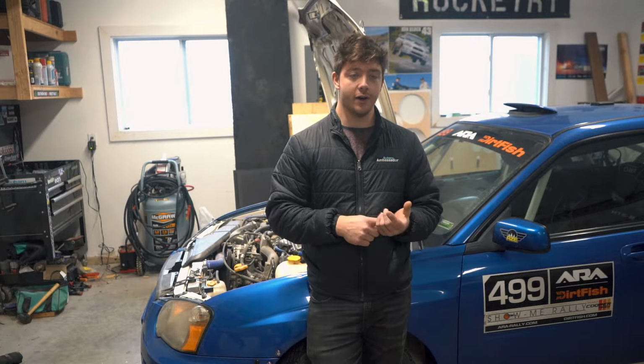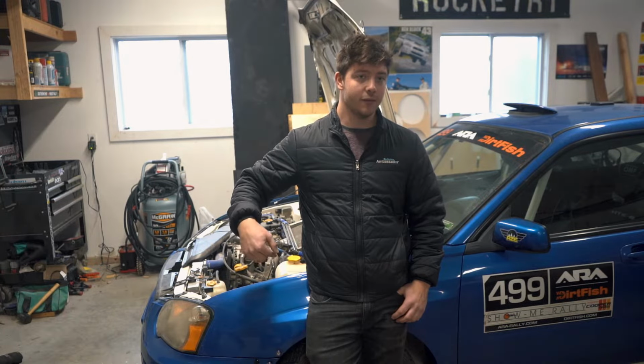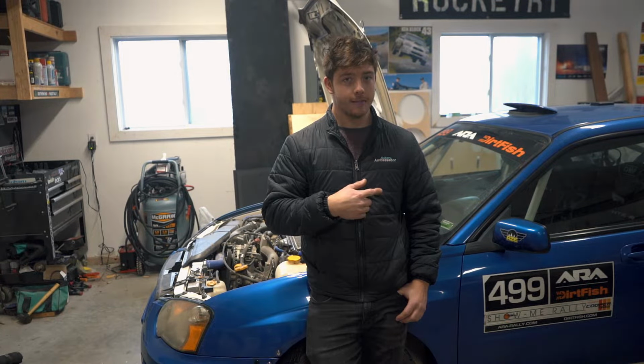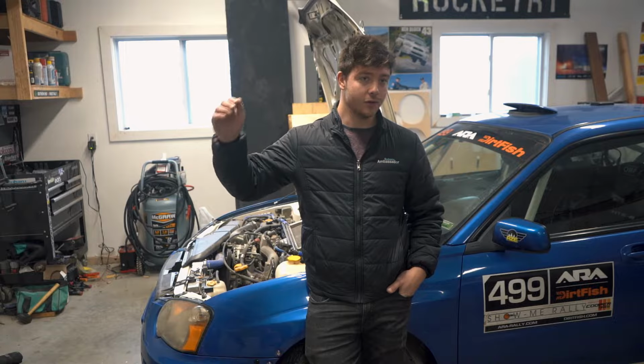So pretty much every rally car has those, along with underbody protection along the whole car, because the gravel will just eat through everything, and a 1/4-inch aluminum skid plate in the front and rear diff cover in the back, because a lot of times there's rocks the size of, like, people call them baby heads, and if you hit one of those, or you slide off the road and hit a big stump, it can go straight through your oil pan or your transmission or diff, and you'll be done. And cost you a lot of money. So good skid plates are a must for rally for sure.